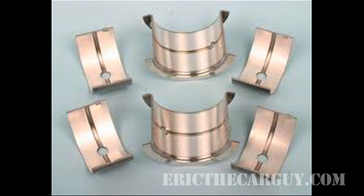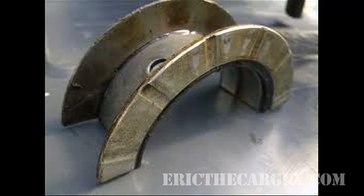The other thing I wanted to mention is that if the thrust bearings go bad, it's not necessarily going to cause the engine to not start. It might cause a slow crank, some noise, or other strange things — so always look for these possible mechanical causes. Also, if you're doing a clutch job, it's a good idea to grab the flywheel and pull it back and push it in to feel for any movement. If you feel movement, it could indicate a problem with the thrust bearings, and that should be addressed, particularly if you're having clutch issues or the engine isn't running properly.